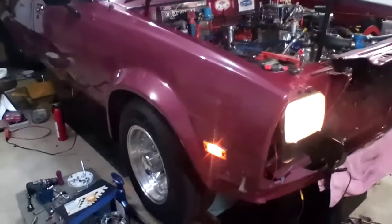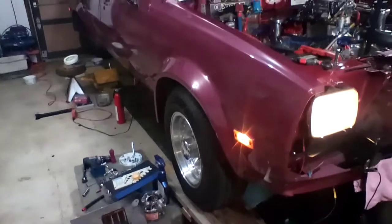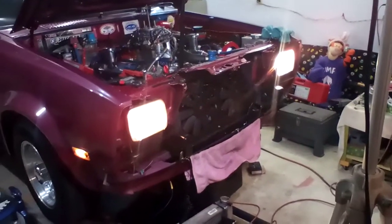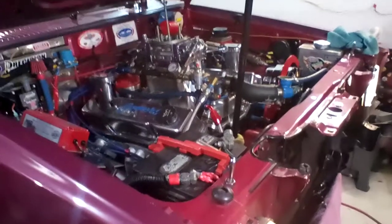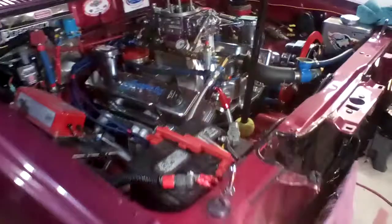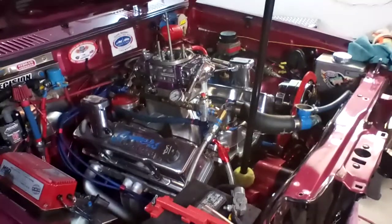And I can get up to a 14-inch footprint tire up under it. Right now, on the ground, that one sets 12. And actually, it doesn't do too bad on gas with the differential gearing I have, that 3.07 I had in there. Originally, I had a 4.56, 4.10, and then I stuck with a 3.73. Then I removed that to drop the RPMs down so I can make it more streetable. And I replaced it with a 3.07. Great little truck.